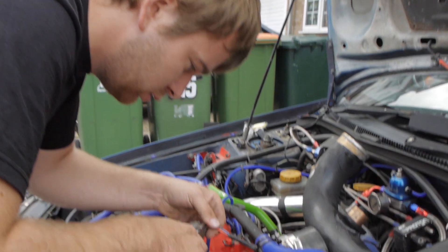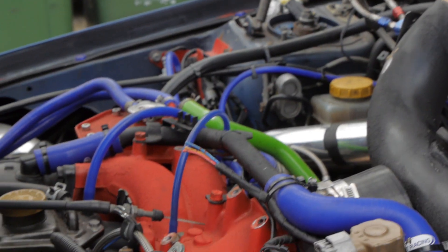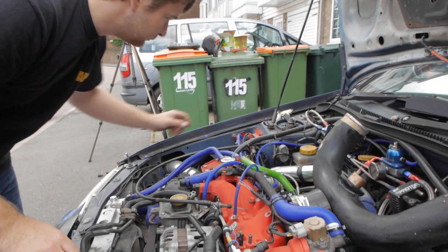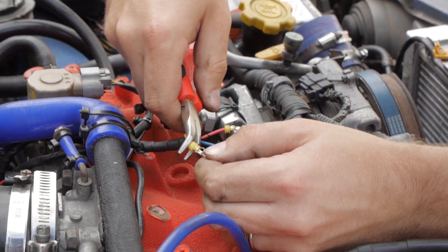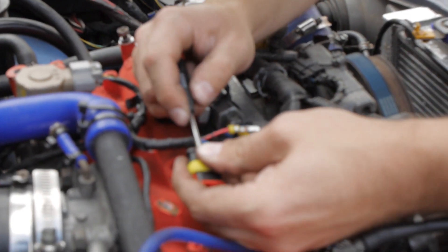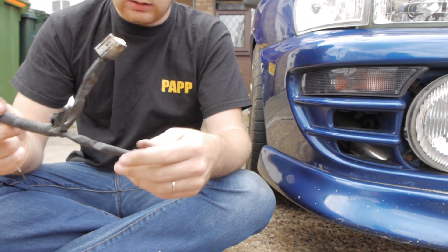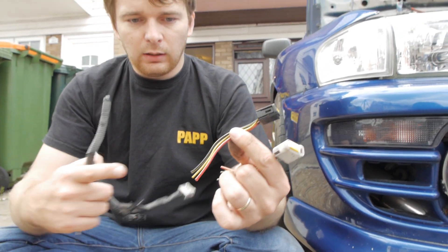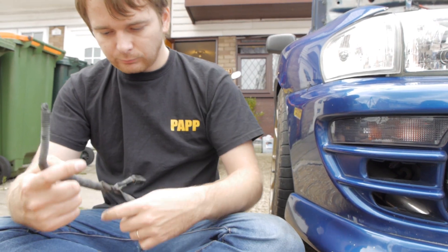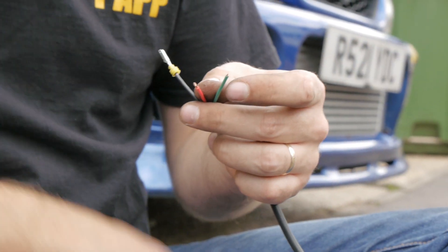So we don't need this anymore. In true stupid style, we're going to cut it as short as possible. No more way back now. We have the coil packs which we're going to remove — comes with a factory loom like that, cut in pieces. So what we're going to do, we're going to prepare this, clean it up a bit, and end up with something tidy, which we're then going to extend the wires from and get our new loom into it. Strip the wire with the strippers — maybe a bit too long, but all right.